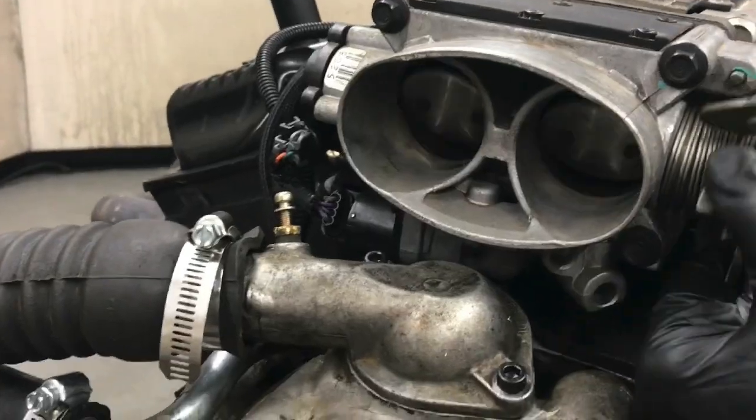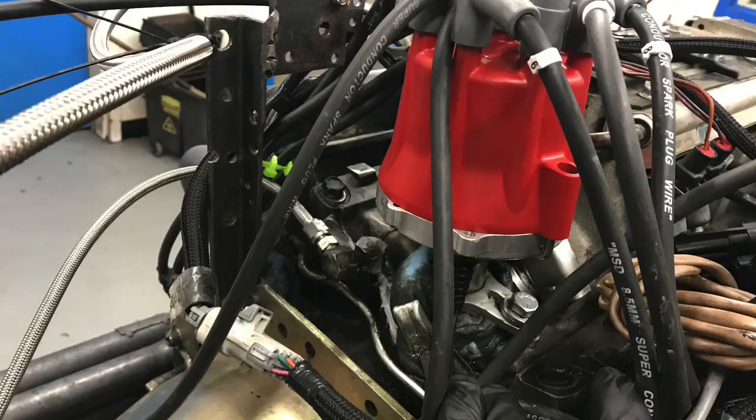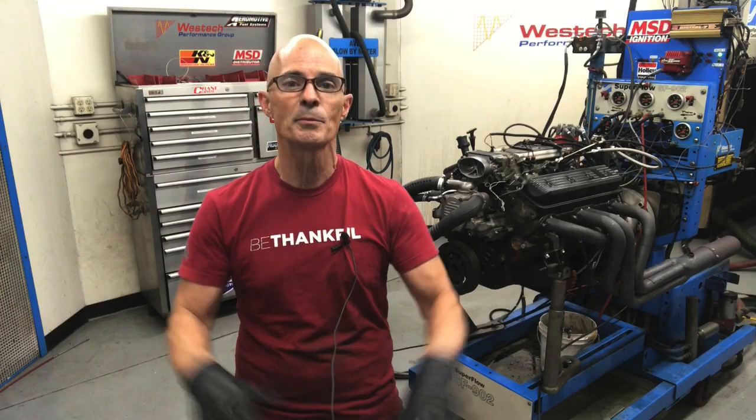More importantly, the second question: did it work? In this video, we finally got the fuel injected intake manifold on our L99 4.3 liter V8. That's right, we got our LT1-based EFI intake up on this motor, ready to run, but it was not without its challenges. I thought it would be a good idea to install a distributor in this intake manifold. I did not want to run the OptiSpark, so I decided let's just run a distributor so I can use the Holley and do all the tuning myself.